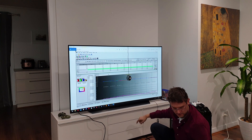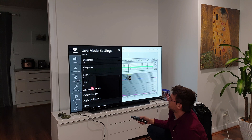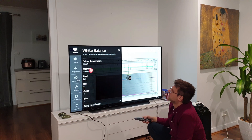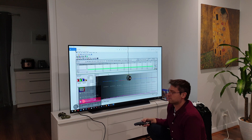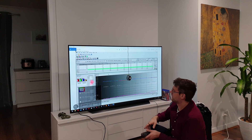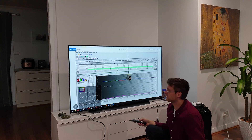When I talk about 2-point calibration, let me show you what I mean. If you go to Advanced Controls and then White Balance, you can choose a method — 2-point, 10-point, or 22-point. These give you more options to calibrate across the full grayscale range. I just did 2-point, which means you have a low point and a high point. That's all I did so far, nothing else.